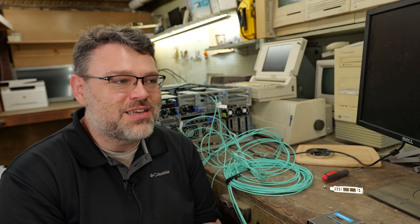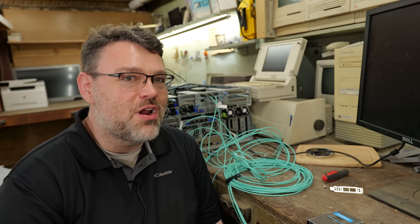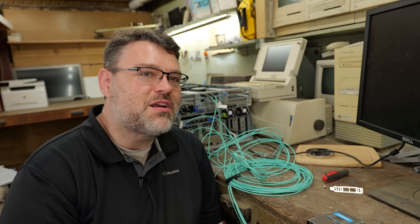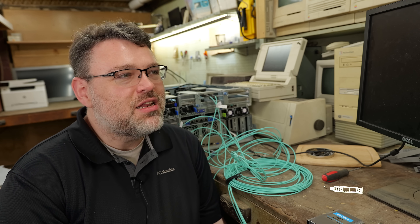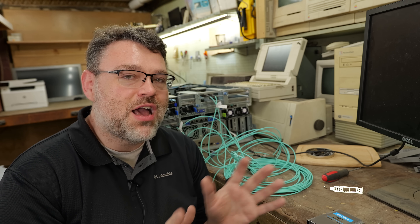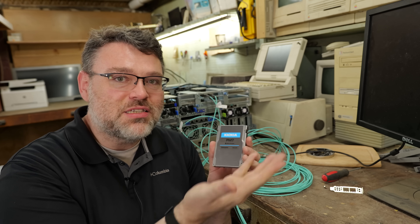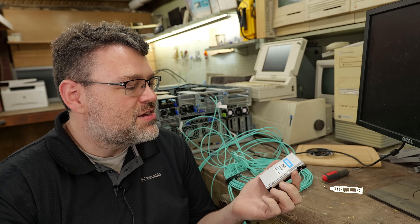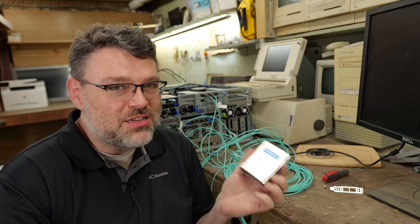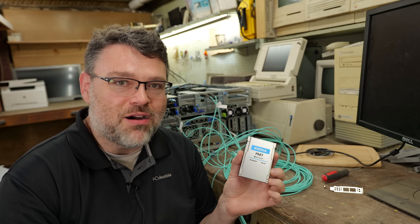There are servers out there with SAS SSDs and hardware RAID controllers, and people aren't comfortable moving to an entirely new platform with NVMe — we don't have solutions for some problems in some scenarios. But by and large, it's basically: let's make a middle-tier product that will let you drop flash into the middle of your serial-attached SCSI ecosystem. And that's what this is — a serial-attached SCSI ecosystem product that technically shouldn't need to exist, but because we're in this middle-of-the-road transition, it does exist for now.